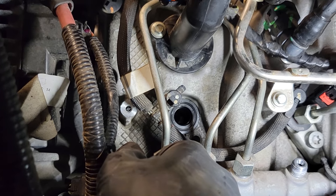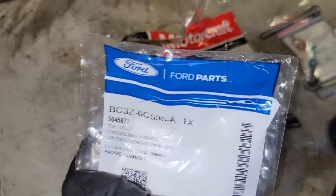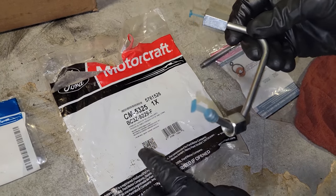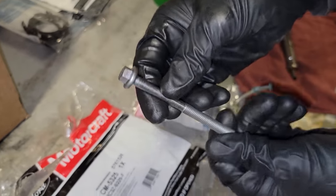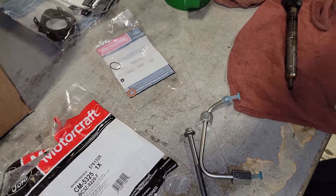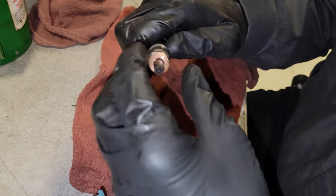The next thing to show you guys is the injector seal kit you're going to need. You cannot just put the injector back in — you have to reseal it. The part number for the injector seal kit is specific: there are two different kits — four kits for injectors like this and four for the other injectors that have the curve in them. The kit comes with a new fuel line, a new one-time-use bolt — do not reuse it — and three seals. I'll put a link in the description for the other injector seal video.